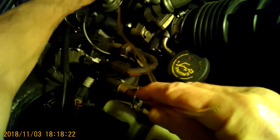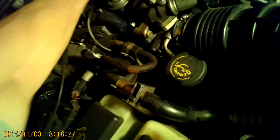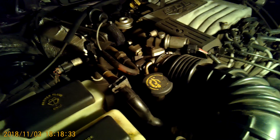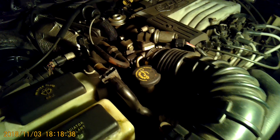With that test complete, we know that we don't have to take that off. If we are getting the P0402 error code, that more than likely means it's something other than the EGR valve, so we have to keep going.